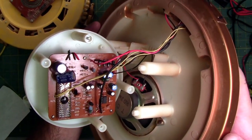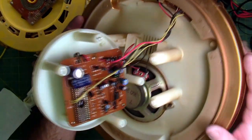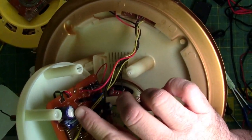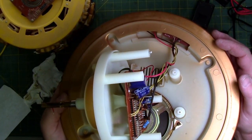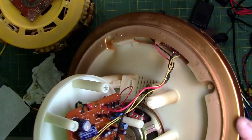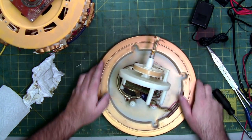We've got four Phillips screws recessed down these pillars — they're long screws. This has seen some moisture. We might have a bad component. Here's the circuitry — there's the blob chip which controls pretty much everything, discrete components that help with timing and sound, and the sound chip right there. But this angled capacitor is rusty, and the bottom is actually bulged — not the top. Usually a capacitor bulges up here. The bottom being bulged might be causing some of the intermittent problem. This other capacitor isn't fully domed but is probably on its way. I'm questioning these two.